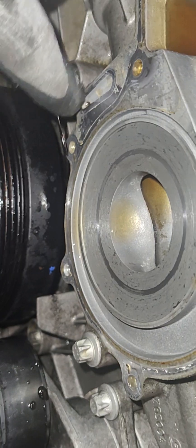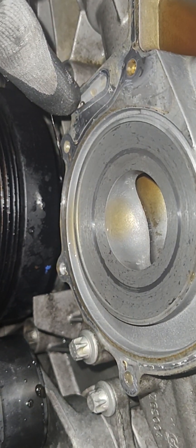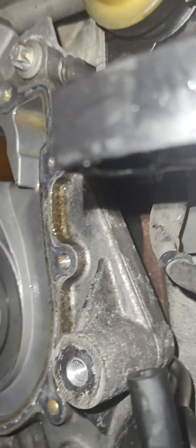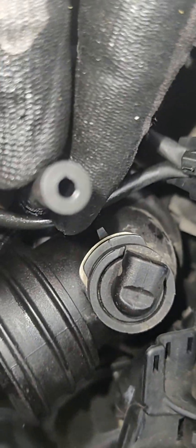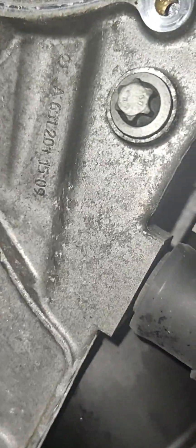WD-40 is in there right now. When you go back in with this water pump, it's very important that you blow this hole out, because there's coolant in here and you'll suck it right back into where you just cleared it from. Clean out these lines — some people say don't bother, but you have to clean them so the next technician doesn't see residue and misdiagnose it as a bad water pump.